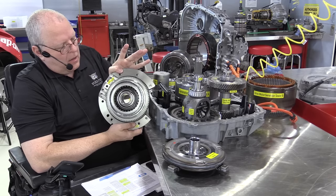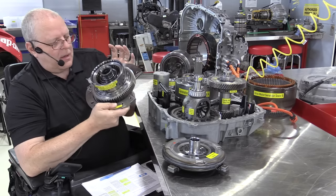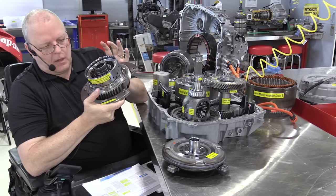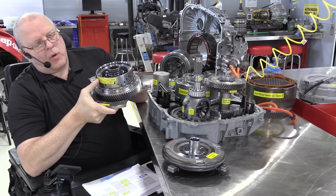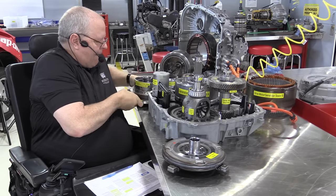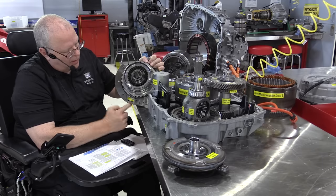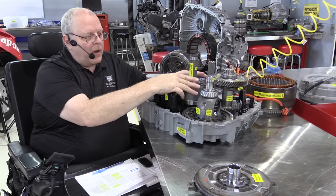As you can see, the transfer drive gear rotates smoothly. To my knowledge, from what I can see in the service information, if the bearing goes bad for that transfer drive gear, you're replacing the whole center support section here, except for this clutch pack housing. It can be removed separately. It does have some clutch passages over here, hydraulic passages for the variable low 1-2 reverse and the variable high 2-3-4 clutch. Before I go any farther, I've got to remove